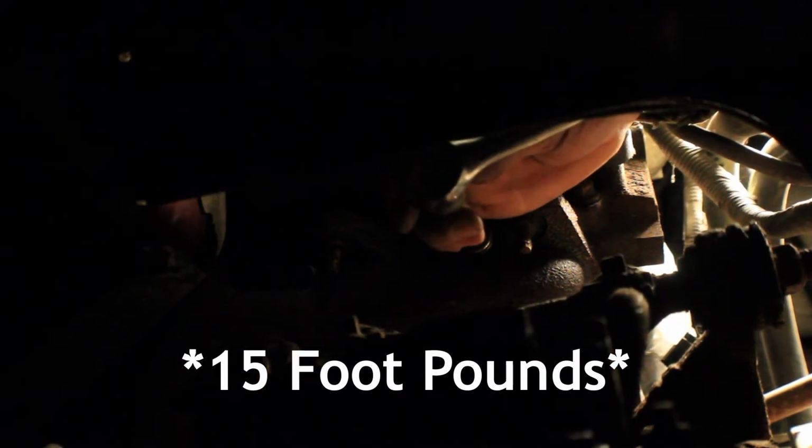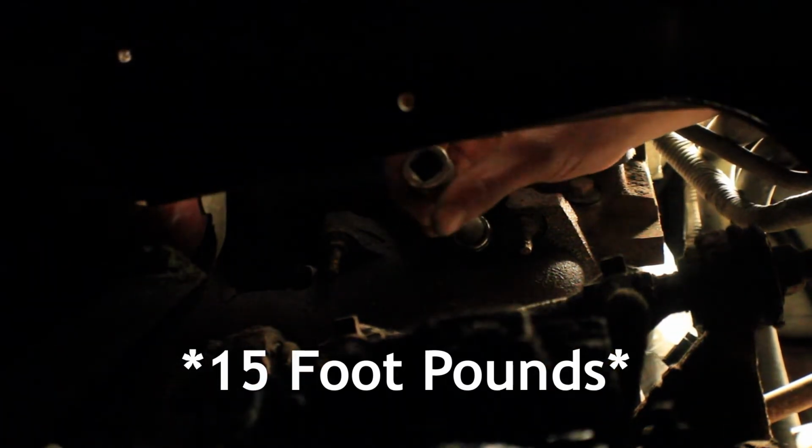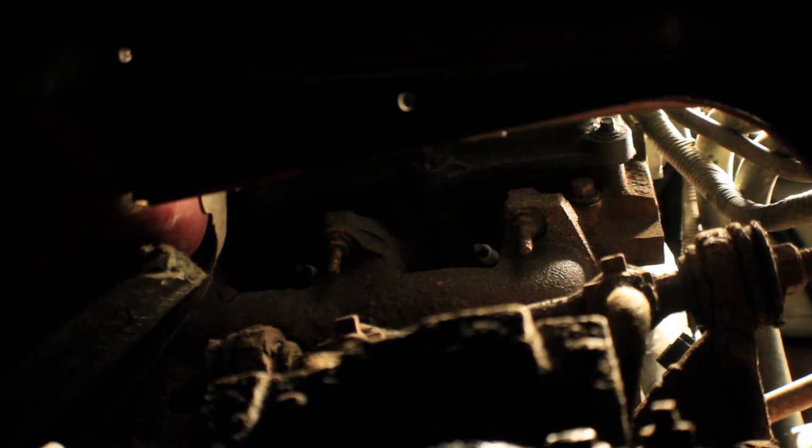All right. Okay. Popped loose. Then they spin out pretty easily. I turn it out a little bit, turn it back in, turn it out just a little. And then I'm going to take the air gun and spray around in there to blow that rust out of there. Because the first spark plug I replaced had a bunch of rust around the spark plug hole. So you don't want any of that to fall in there or gum up threads. So I'm going to take a blow gun, blow that out, and then take the spark plug out